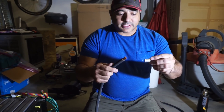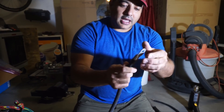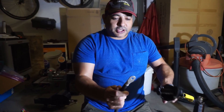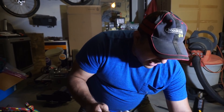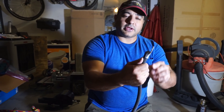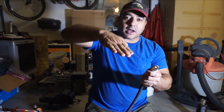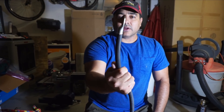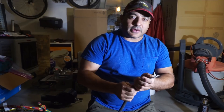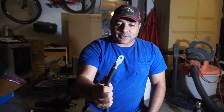We take one of the connectors — we bought some connectors — and a lot of people like to spin these on here just to make sure no stray wire hairs get out. You can spin that on there and it'll sit pretty much flush. Then we put it in the giant crimper and crimp it. Afterward we take a piece of heat shrink almost all the way to where there's lettering. Because these are so close, we put it in a vise and bend the tab up at about a 45-degree angle using a little hammer, so they'll fit right.